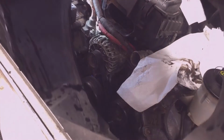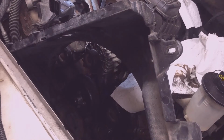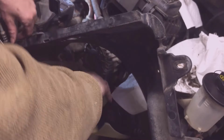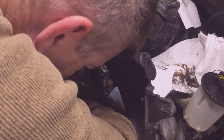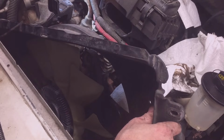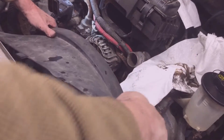Shroud, get it up here. And fan clutch assembly. That can go down in here. And probably need to move the whole shroud. Get going here. Push it flat, and then give it a turn. I think when I cross thread, it's got fine threads, so be careful with it. It should thread on really easy, those fine threads. Better job with my shroud.